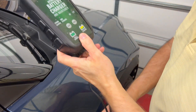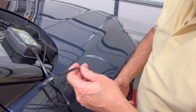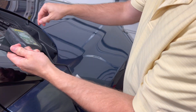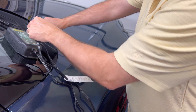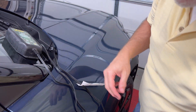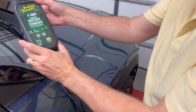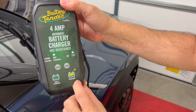Several months ago I did a video on installing a battery tender to the Fisker Ocean, and today I'm going to be doing a test. I'm connecting the lead from the tender to the car, which I have hidden underneath the windshield wiper area. I connect it here and now it's connected to the 12-volt battery. Then I connect the tender to an outlet — it turns on, and this is an AGM 12-volt battery and it is charging.